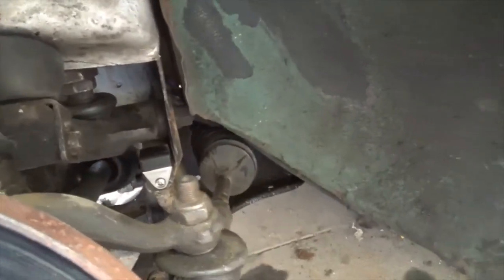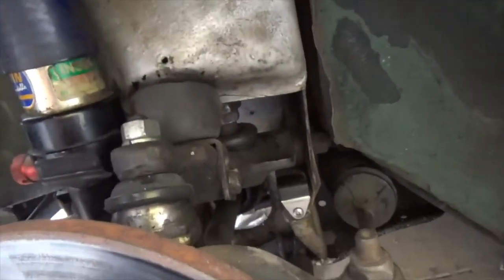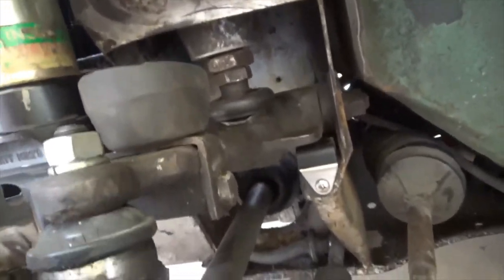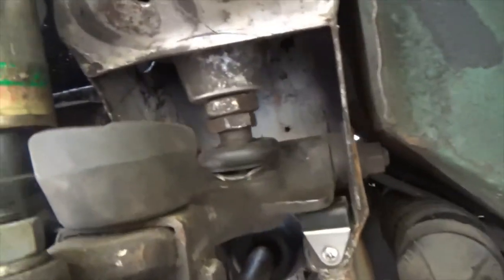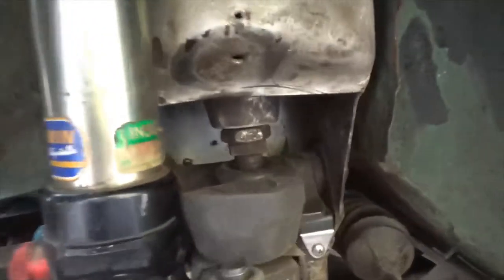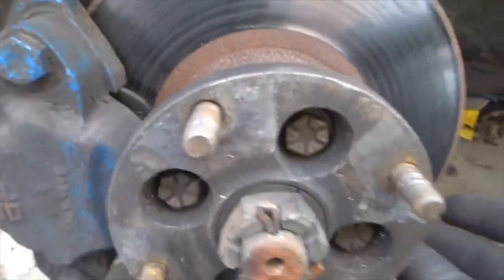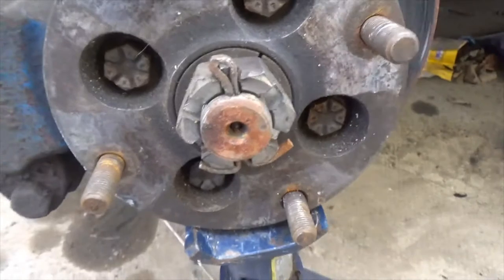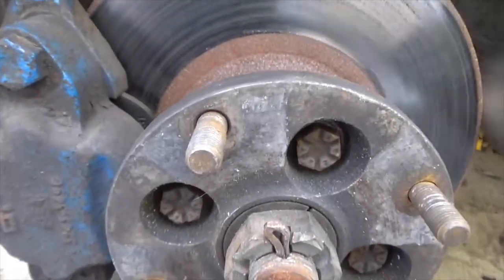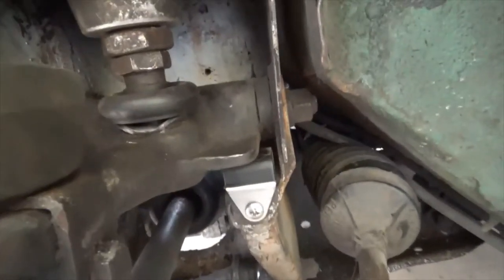It's got to be one of the easiest tuning jobs on a Mini, surely. As you can see, we now have control over what the top arm does — suspension travel's been limited. So now when the car's in a full roll position, this wheel will be less likely to trail down to the floor, carrying the weight of the car down to the floor, as opposed to hanging the weight in the air. If the weight was hung in the air, the weight will pull the car down, whereas this weight is travelling to the floor and letting the body roll onto the other side. Whereas with these little bump stops here, that stops that weight.